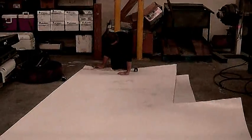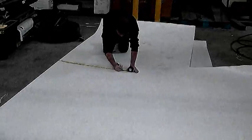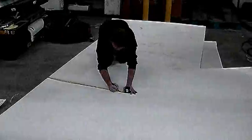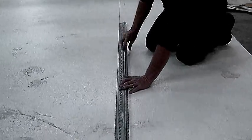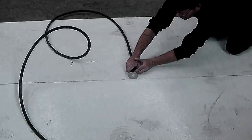When you are cutting the panel, make sure you have a big work area with good ventilation and wear a mask. For your lines to be straight and accurate, measure 5 to 6 points from the factory cut side of the new panel to be cut. You can use a cut-off saw to make the cut. Make sure that you put a 2x4 under the fiberglass to make it easier to cut. To help keep cuts straight, make sure you have some way to support your hand while cutting.